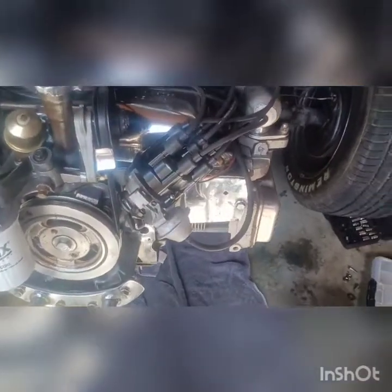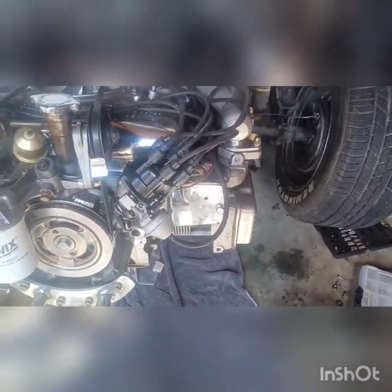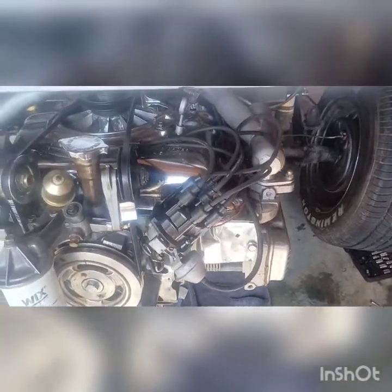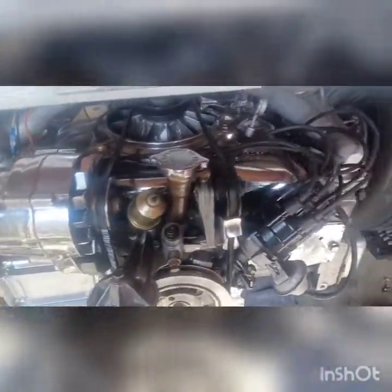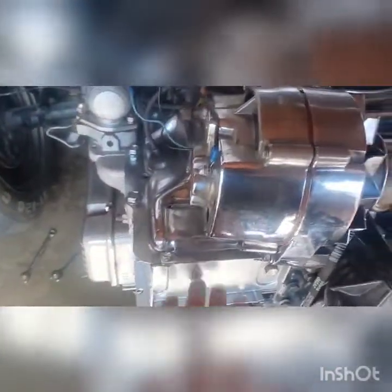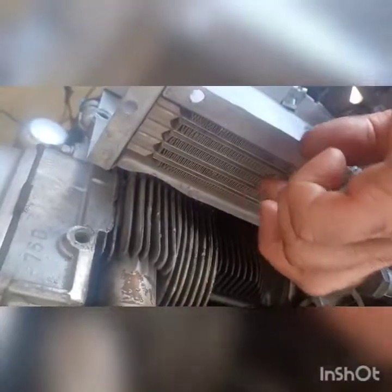This part of the video is just to talk about the sealing. There was a lot of cooling air escaping that could have been pushed through the engine but was going out holes instead. One baffle was already there, which is good — that's keeping the air going down. This is the new, or used but new to this car, oil cooler, and that's the folded fin type. You can look down there and see the fins.